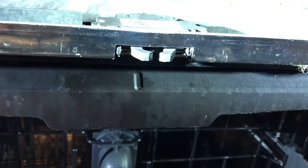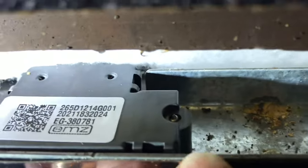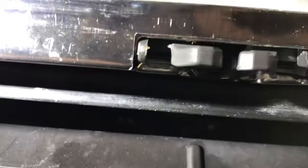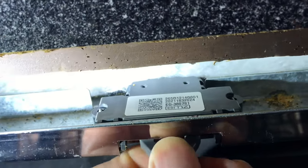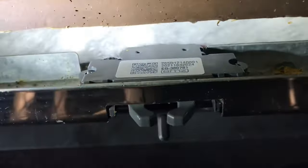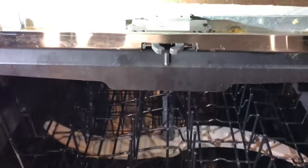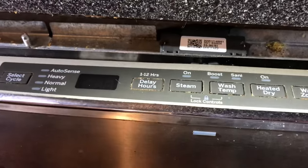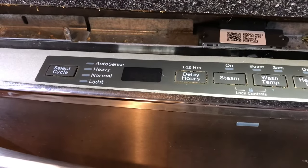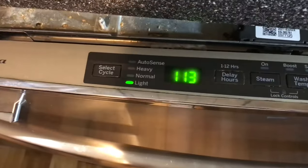The screws barely poke through the plastic — you can see that underneath, nice and flush but not too tight. Check the door switch action — nice and tight and springy on the new one compared to the worn-out old one. Before fully reinstalling, double-check with a solid latch, then turn the power back on and see if it works.